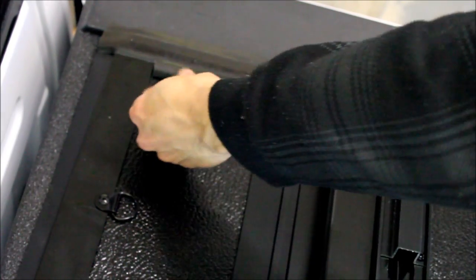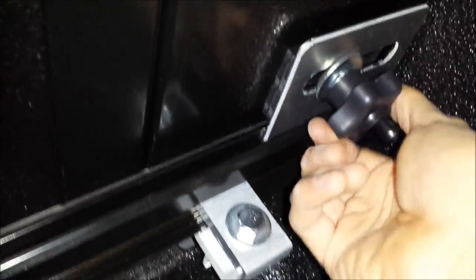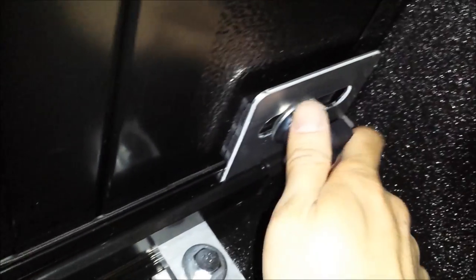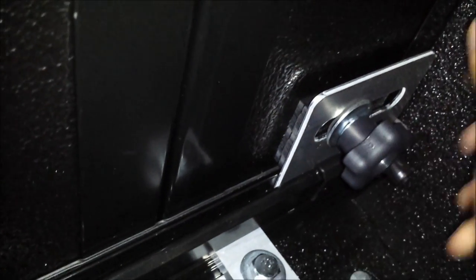Now you're ready to secure the front portion of the tonneau cover to the truck. What's involved is installing a bolt into those holes — your rubber washer comes up, then your metal washer, then a lock washer, and then just hand-thread it in. Here we are underneath tightening it — rubber washer, then the metal one, then the locking washer, and snug it down by hand. Don't over-tighten this because the sheet isn't that strong; you can suck in and pull the aluminum and end up with a divot on top. Just make it snug.